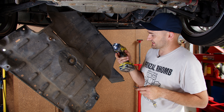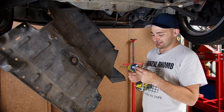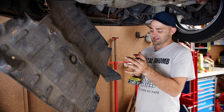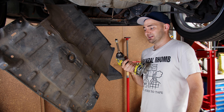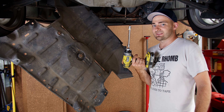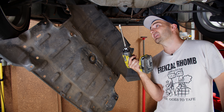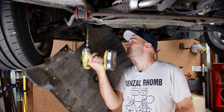One of my favourite tools — we call these Dak Daks. I think they're called impact drivers. It's like a three-speed Ryobi one. These adapters are worth their weight in gold. They adapt from the normal hex standard that these things use and clip in so they don't come out, and then from there you can add your own sockets — three-eighths in this case — extensions, all sorts of stuff. It's so fast. I know that my friend Moog likes to use hand tools as much as possible. I do too, but Turbo Yoda once said that if you can save your wrists, you should save your wrists. These things come in really, really handy. It doesn't work on stuff that's seized that well — it doesn't have the torque for it — but it'll do these quick boltings and undoings really fast, which is awesome.